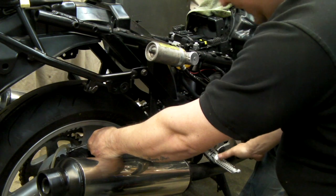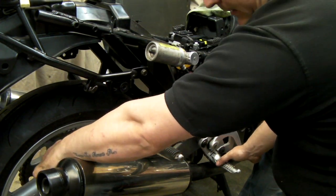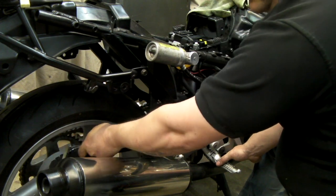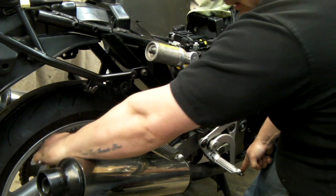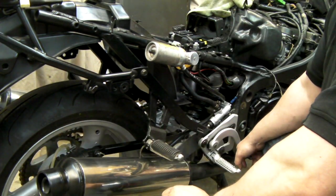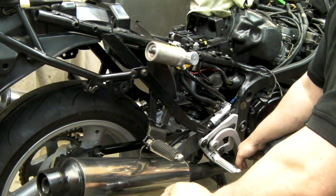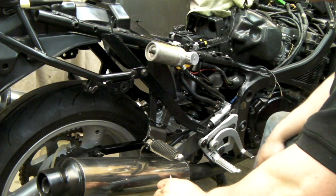Open the valve, press the pedal, close — and we repeat that process a lot. Open with an 8mm spanner, press pedal, close. We repeat until we get no more bubbles, keeping an eye on the reservoir level and topping it up as necessary.